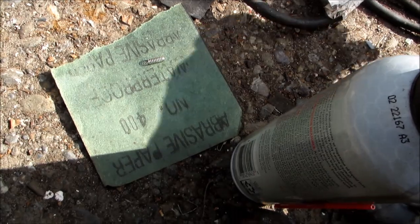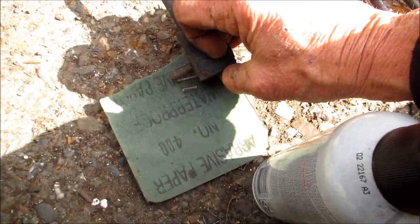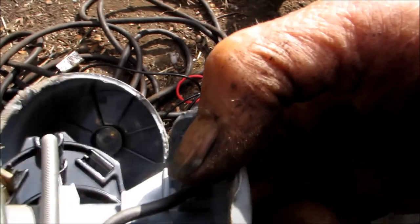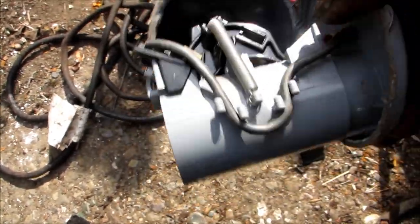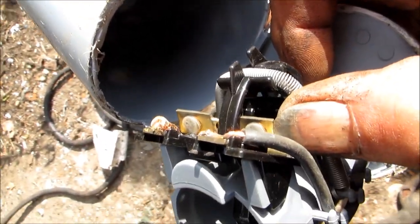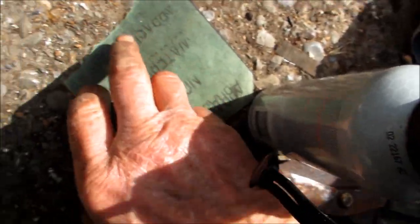That spring is roughly not quite the size of that prong there. I'm going to stretch it apart with my fingers and put it back in — there are just two little tabs in there that hold it in place. The points are pretty clean but they don't quite make good contact unless I push it down by hand, so stretching the spring should give more pressure.